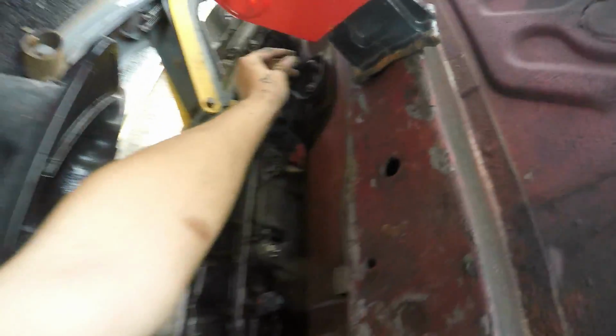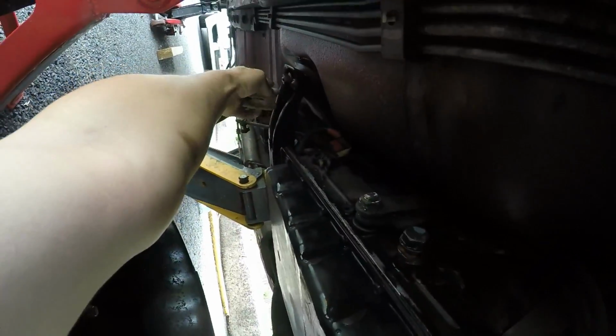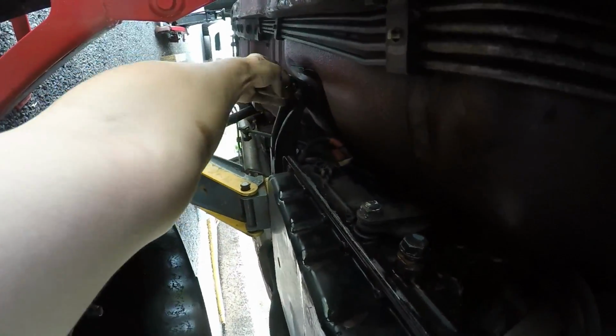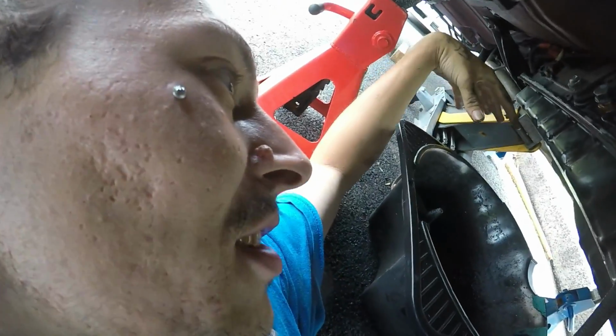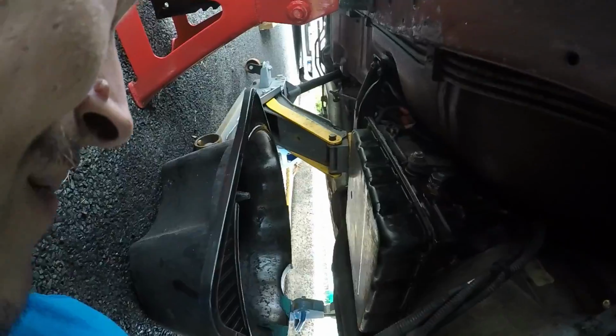Alright, so we jacked up the jack so we can see our studs through the cross member. They don't have to get screwed all the way on, just as much as the nut has protruded the stud, so that every bit of the nut has been used on the thread of the stud. We don't even need to put all 4 in, 3 of it will do the trick. Just so we can get the pressure.